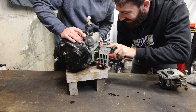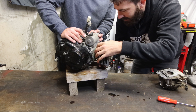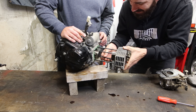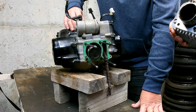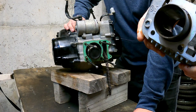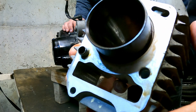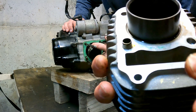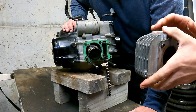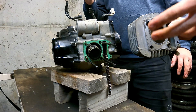That's surprising — it's been seized before or run without any oil. I reckon that's from before I got it. I was not expecting to see that. You might have to pull that camera off and get a good look at that. It's had a seize, or it's been hopped and picked up. You can see where it's picked up in the barrel — that's not just a little score, it's freaking divots, and it's the whole way up the barrel. This is actually on the top side. Possibly less oiling on that side due to the nature of the way the engine sits.